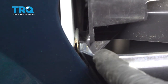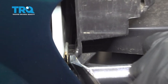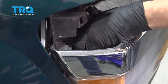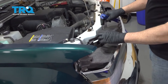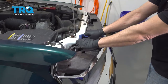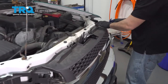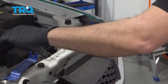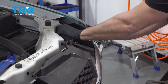On the outer edge of the chrome grille trim, there is a plastic mounting tab right in there and we want to separate that. You can try a plastic trim tool or maybe just tugging on the top of the grille gently here and work our way across the front and across the bottom.